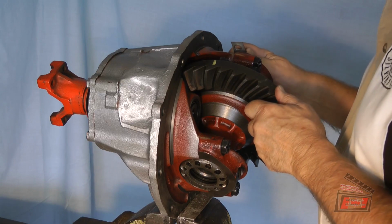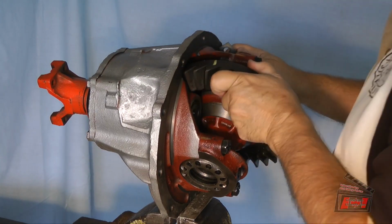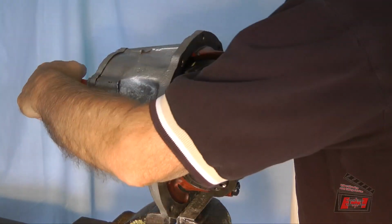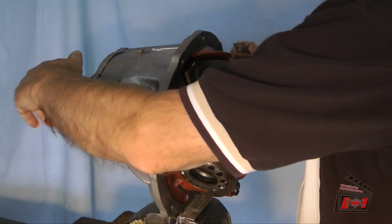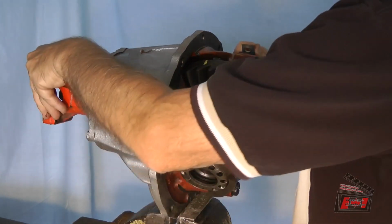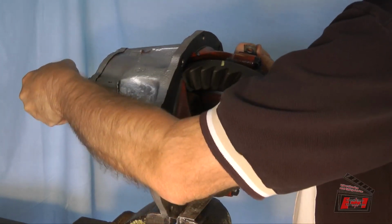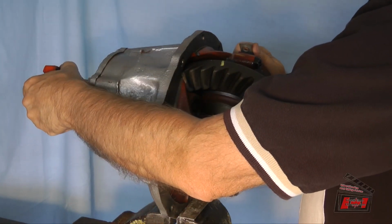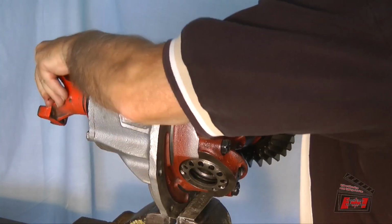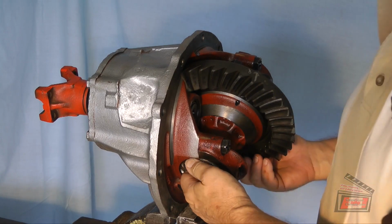So there's 1 notch. Still a little bit. 1.5. Okay, I would say 1.5 and the backlash has gone, but let's rotate it. Ooh, that's pretty tight. Yeah, that one's still loose. Okay, no backlash. Check all the way around. So then it says, tighten this one up till it just touches. Can you still see? Yeah, I think so.